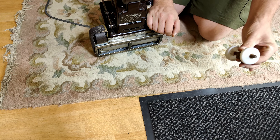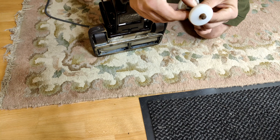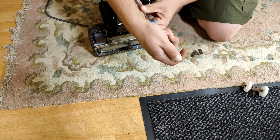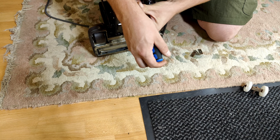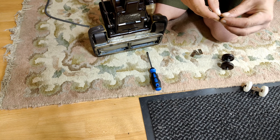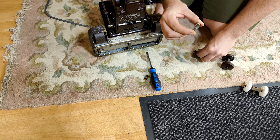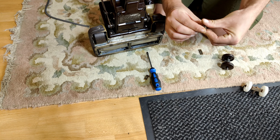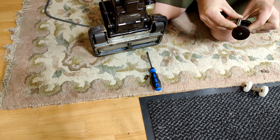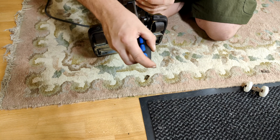It's got its bottom piece which would probably clean up okay, but what I'm interested in now is this back axle - once I've taken these random junior wheels off, it should be perfectly good. But we want some of these shims - these are the shims that shim up a junior's height adjustment. You don't do it automatically; you have to take a screwdriver and undo it all. This has a lot of shims, and it's also got some bits of cardboard which were in it when we arrived. That's three big shims, one medium, and two small ones. Let's put all but the other thick one in - that's got to raise it a fair bit.